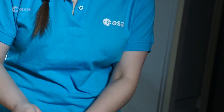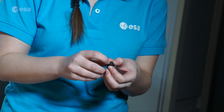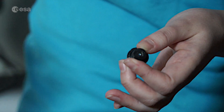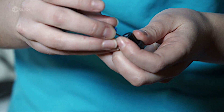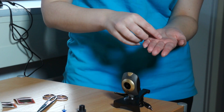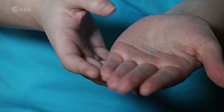Inside, you're going to see a small piece of tinted glass. You'll notice that it has a reddish-green tint, and it's exactly what we need to remove in order to allow our camera to detect infrared radiation. The easiest way to do this is by taking something sharp like a small pin, gently inserting it into the side, and popping it up like so. Please be careful, as depending on how hard the filter is stuck inside, it can shatter when you pop it out.